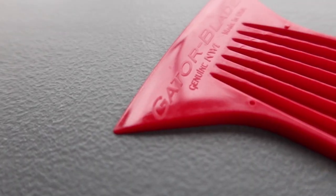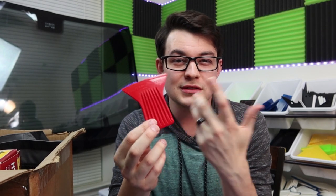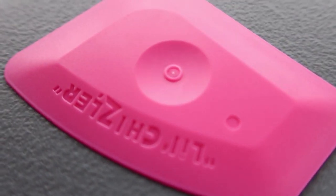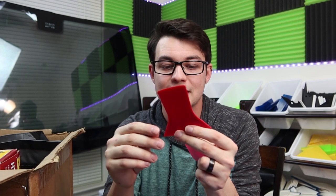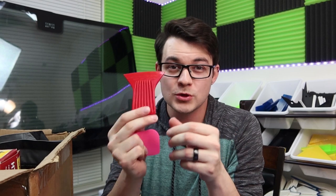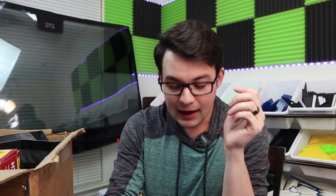This is the newer Gator Blade - I like the yellow and red ones. I don't believe there's any hardness difference between them; I think they just changed the color one day. For any soft scraping I'll go to the Gator Blade. This is the little Chiseler, and I've never actually liked these because they have a slightly different lip on the ends and just haven't quite sat well with me. The Gator Blade is a little flatter on the edges - they're really stiff and have more angles for pressing different types of folds, creases, and dirt specs. As an all-around tool, get yourself a Gator Blade. The Chiseler is still great for touch-ups but it's kind of a one-trick pony.